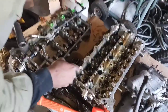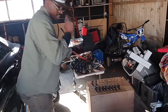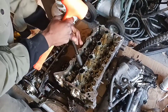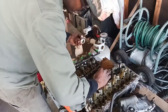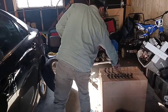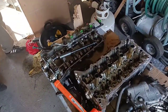You also want to make sure you have a magnet, so when these little locking keys fall, you can grab them with the magnet. You want to keep everything together — those are critical for reassembly, so try not to lose them. For reinstallation, I will have to use my specialty tool. I haven't figured out an alternate technique yet to reinstall the springs without the tool, but I'm working on it.